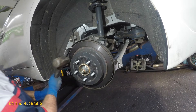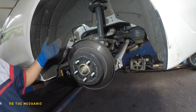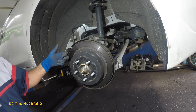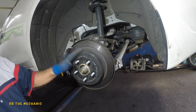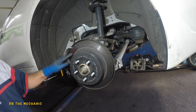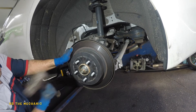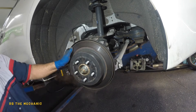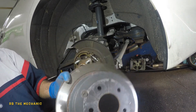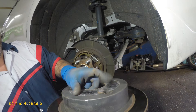If you're reusing this rotor, you don't want to bang directly on it because you'll leave dents and dings and warp the rotor. If you're resurfacing it, there's no need — resurfacing costs just as much as getting new rotors, and if they make any kind of warp or cut it wrong you'll get a shake and pulsation and end up doing it again. Better to do it properly the first time. You do need to remove this little plastic piece — just push on it from the back end and it comes right out.